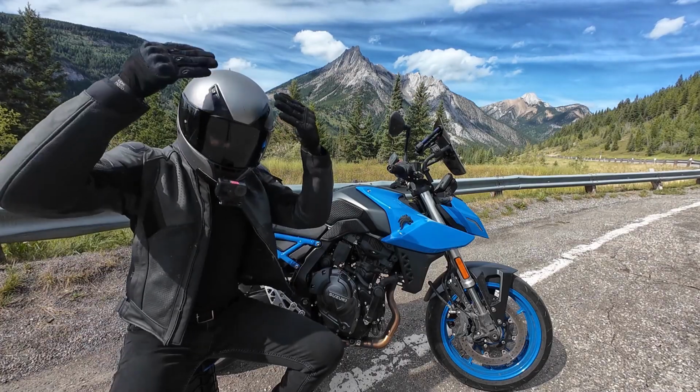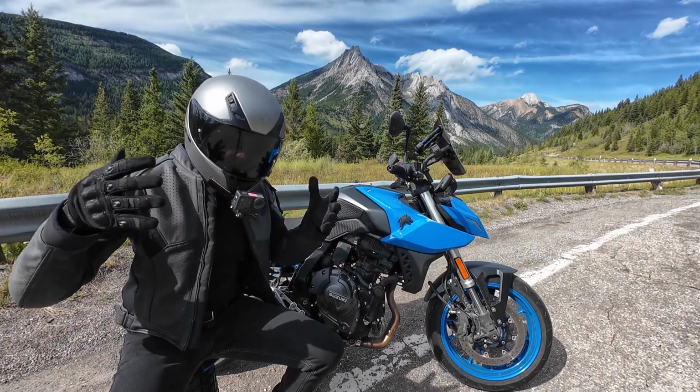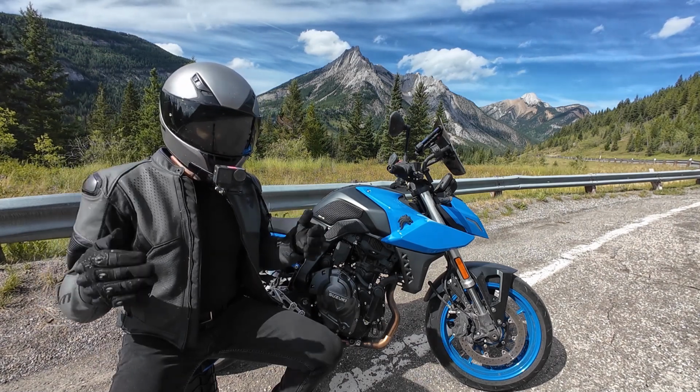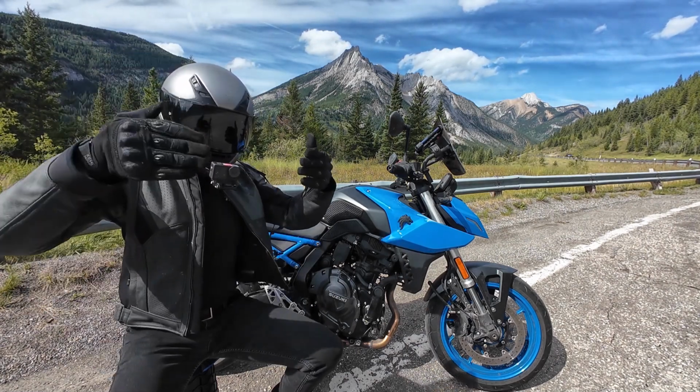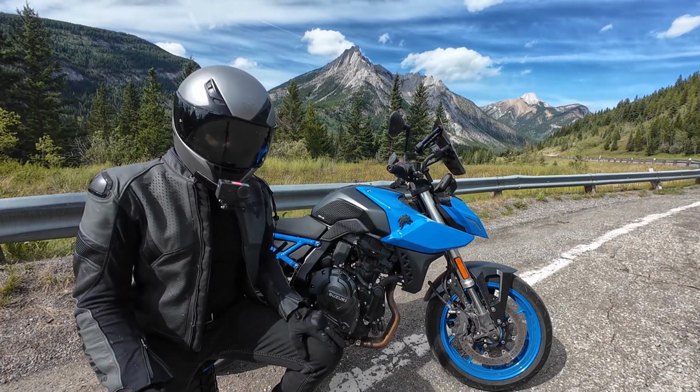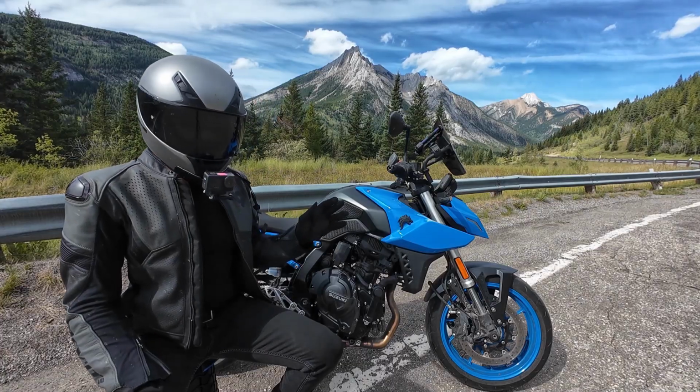You don't want to deflect the air up over your head, because then you're sitting in this pocket of stale air, and I don't know, the CO2 builds up inside the helmet. You want to get fresh air into the helmet, so you don't want to deflect the air up too high. It deflects it up to about nose height, which is just about right for getting fresh air in the helmet scoops. So, I don't know.